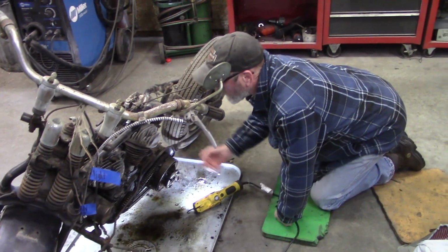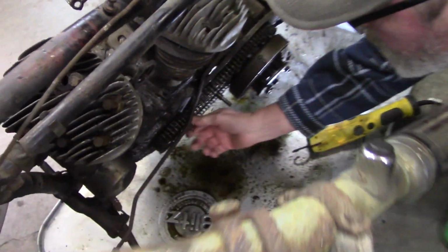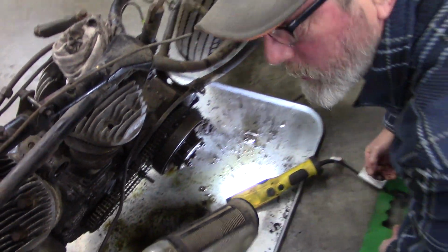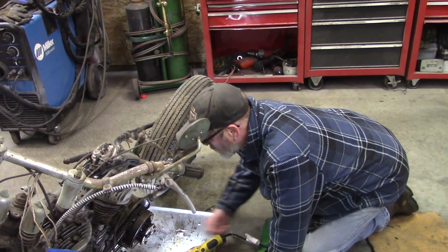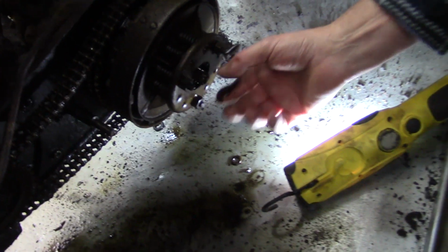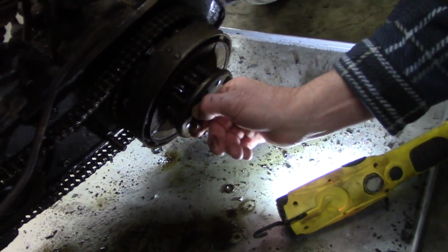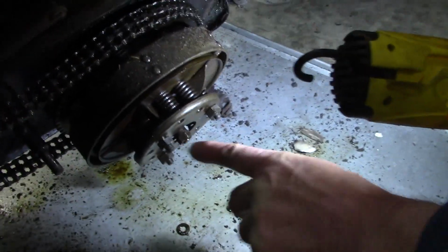When I disconnected the bolts underneath the transmission, I thought I could get this chain loose enough and then get it off, but you can't. It's like half on and half off, and I can't get it off. But you probably got to have it on there anyway if you wanted to take that nut off that's on the clutch. So to properly do this, you would want a bolt that's longer, and you stick it in here and you get some threads on it, and then you get a washer that holds this plate and a nut behind it, and then as you tighten the nut, it would be squeezing all these springs, and then you're not putting tension on here. You'll see the dimple right there, and you'll see this one's not even seated on it.